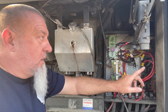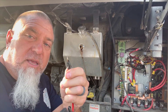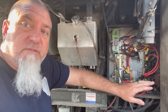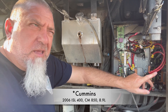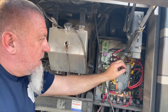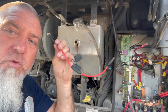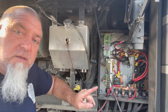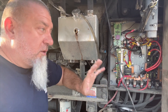But here's the important part. Even without this board, we can still run the rig. I had to go out and get a fused jumper. This originally was a 20 amp, but Frank messaged me back and said he was looking at the schematics — don't do a 20 amp, do a 5 amp. So on this rig — a 2006 ISL 400, I think it's an 8.9 — you take this hotline and jump it to the ECM line by way of your fused jumper. Doing that, you'll be able to start and drive your rig with no issues. It's not a permanent fix — it's to get you out of a bad situation if you're stuck on the side of the road so you have a way to get to a service center.